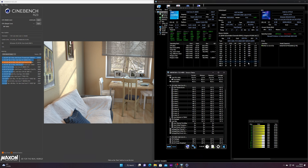It might be worth taking the cooler off, checking the paste, reapplying, and reseating. Or simply check that you've screwed it down properly and it's secured with a good connection. Also note that Cinebench runs things really hot — this won't be a standard load. If you're concerned, play games or do your usual intense activities while running HWInfo at the same time to see the maximum temperatures your CPU reaches.